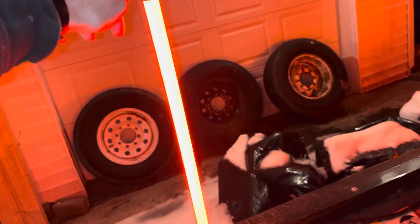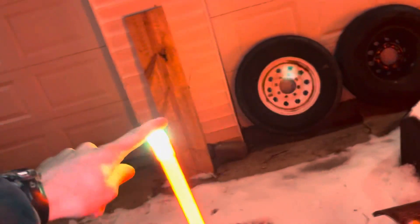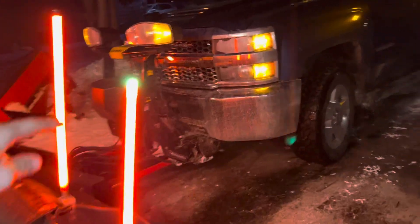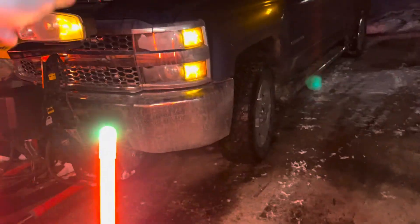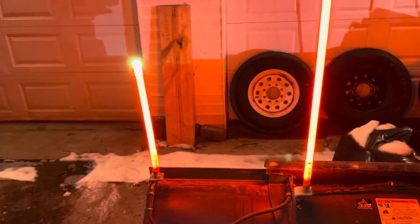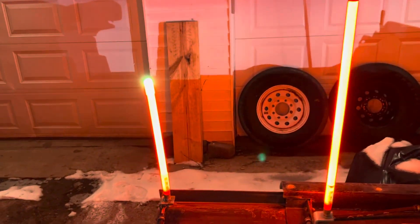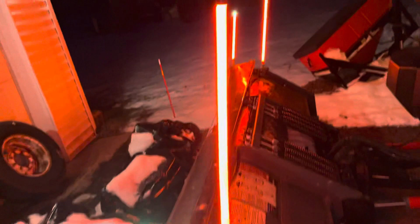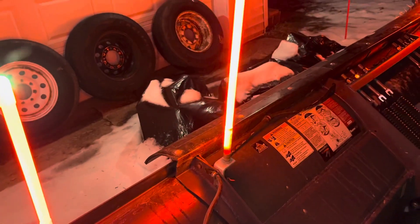I would also make sure you get a slightly shorter marker. The short one here is 18 inches, the tall one is 28 inches. The 28 is a little bit taller than the factory marker and the 18 is a little bit shorter. With a bigger truck like a Chevy, you can barely see the marker when the blade is down over the hood. The yellow cap allows you to actually see it, whereas the black cap you can only see from the red down.